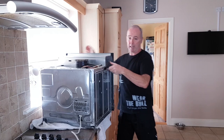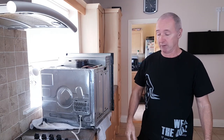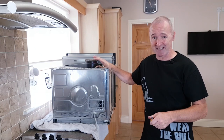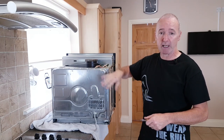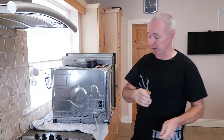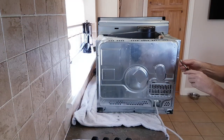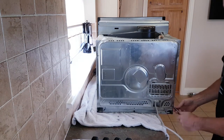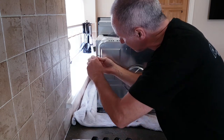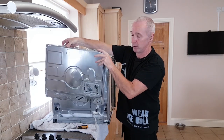They're quite heavy — you might need some help doing it. Now going in at the back: on this Bosch model there are six Torx screws holding the backplate on, size Torx 20. Easy to take out — I've got one out already.